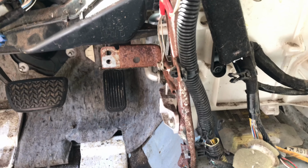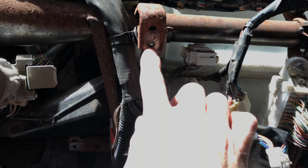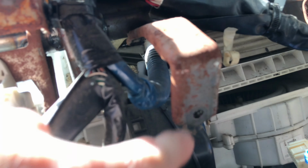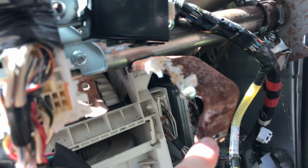Here's the steel brackets. Looking down, there's one screw there. Was a screw or a bolt there. They're really obvious to see from the front. Use a flashlight and get them all. And you'll know if you got them if it starts coming loose. So, multiple bolting points, attachment points. And these are the airbag assembly attachment points. Either those front ones or the ones right behind there.